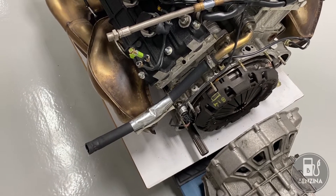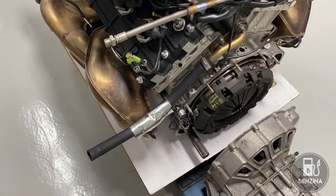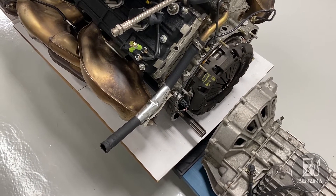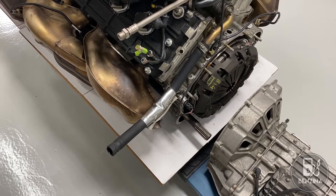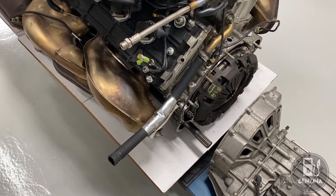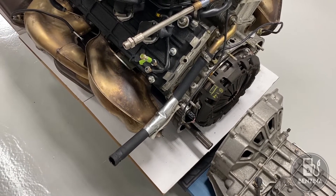So what can we do to fix this? First of all, check your service records. If your service records have not had this hose replaced in any reasonable period of time — one or two years — do it. Anytime that you work on these cars where either the engine comes out or you're anywhere near the cooling system, this hose should be replaced.